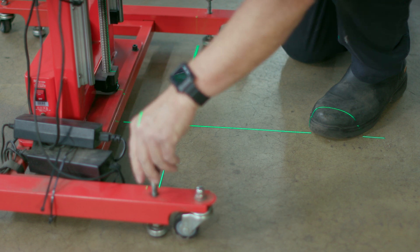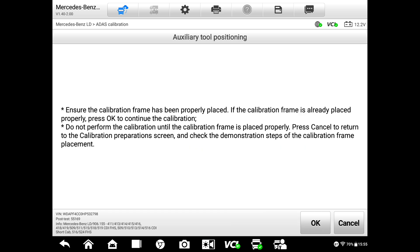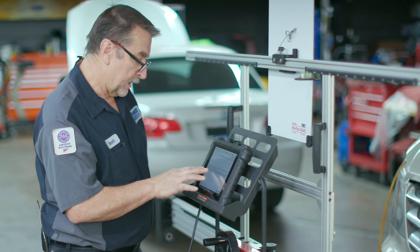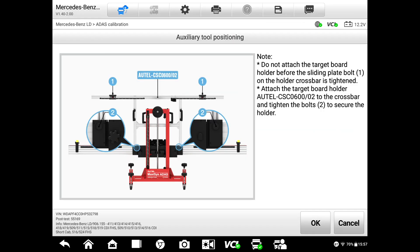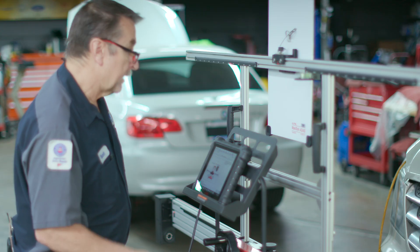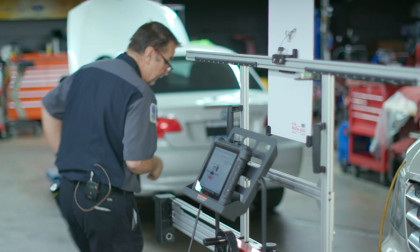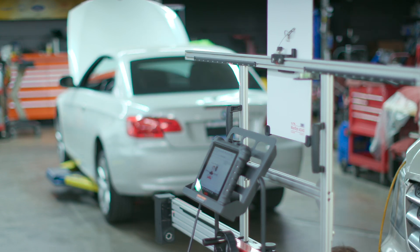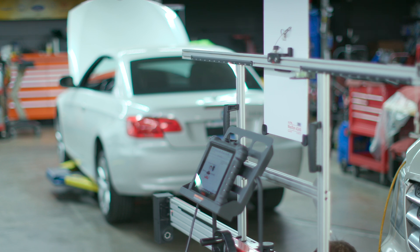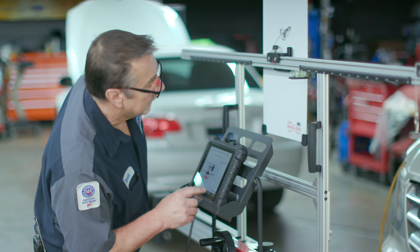We can see our marks on the floor. It says rotate the fine-tuning bolt, so I move it. We go next — the frame has been properly placed. At this point you'll want to add some friction so it won't rotate. Since we've set up the frame properly, we click OK. Ensure the frame has been properly placed — click OK. It says do not attach the target board holder yet, so we've got the bar in there and put our target board on — it's already in place. We make sure the bubbles are centered; I need to raise the front just a little bit until they're centered.